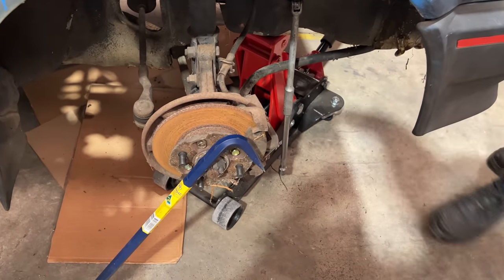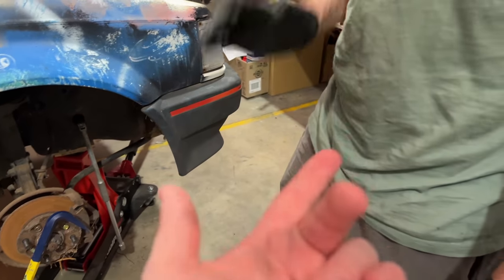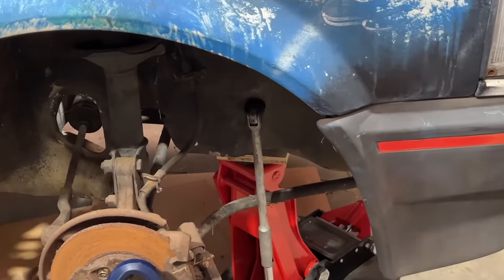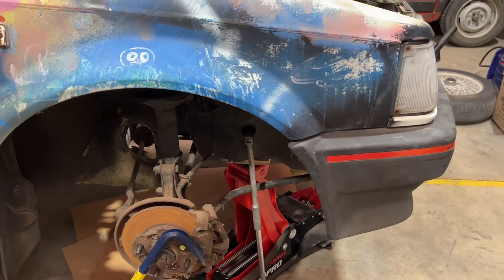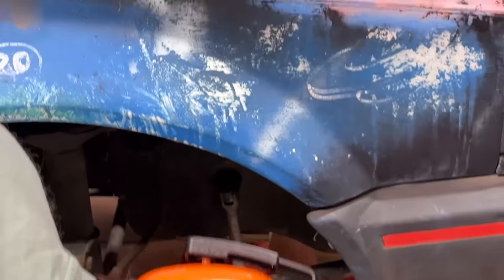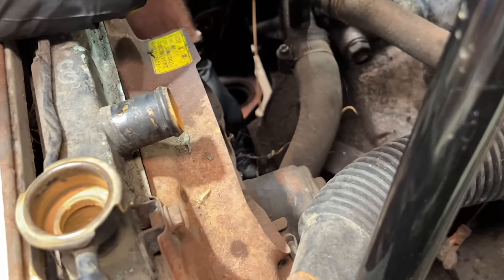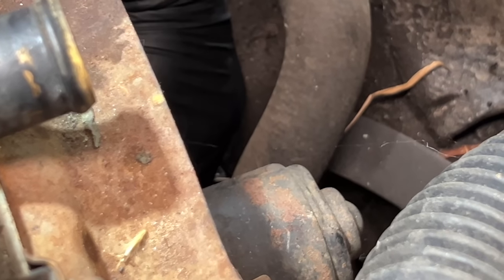This is free old cars, people. We've got a hoist, there's a James, all the equipment you could ever want — and this is nightmarish at the moment. This has ground to a complete halt because this is the main pulley on the crankshaft, and this is an issue. Turns out with research there is a slot that you're meant to put something in to stop it from turning. At least we didn't try for a long, long time.